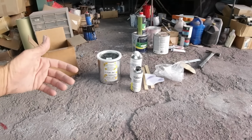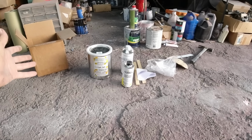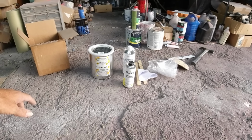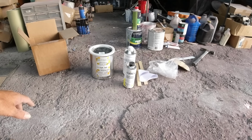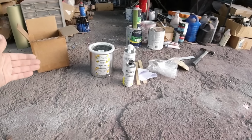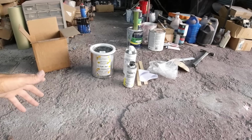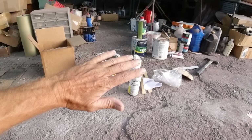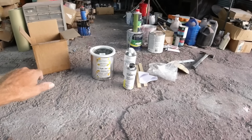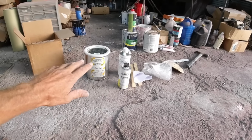That spray can, if you ever want to repaint it properly later on down the road, you're going to have to strip it all down, and it's a very long, tedious process of getting all that crap off. You're basically ruining the paint that you've painted over top of, and you're going to have to strip her down to the metal and start over. So it's completely not what you want to do, okay? Like I said, it's not any cheaper.